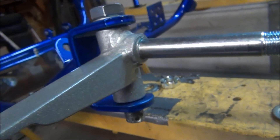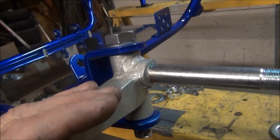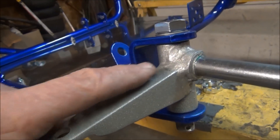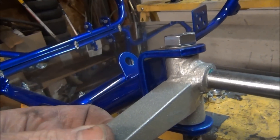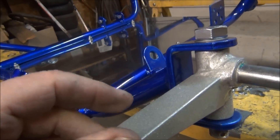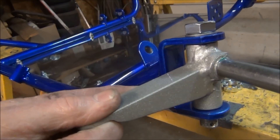A common mistake for everybody that runs these carts is that they let too much slop between the hanger and the spindle. That allows your spindle to prematurely wear and it flops back and forth when it gets a lot of wear in it. If you keep those snugged up, the contact area between the spindle and the hanger does more for keeping your spindle snug than the actual spindle bushing itself does. Initially you want to set these up so they've got quite a bit of drag — they might be hard to steer the first day or two.